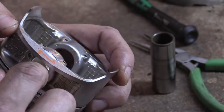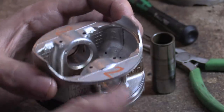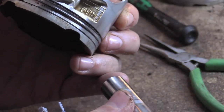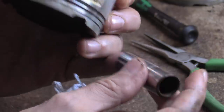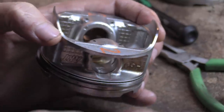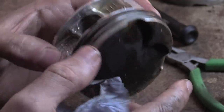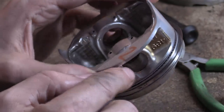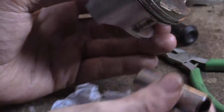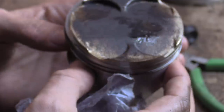There are some chatter marks on the inside of the ring bore — you can see where the wrist pin has moved ever so slightly. Even though the end is there, there's a chamfer on the ends of these pins so they sit a bit further in. Actually, these might be tooling marks because they go all the way out to the bore as well. Quick machining — not really nice, actually. But you can get little chatter marks if the wrist pin is a sloppy fit and it rotates — it'll make little indentations, a bit like brinelling.